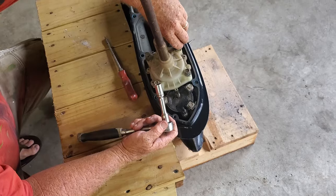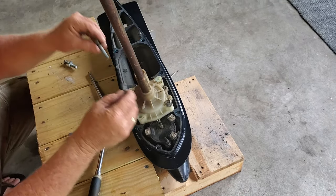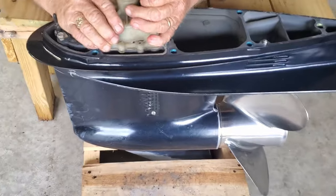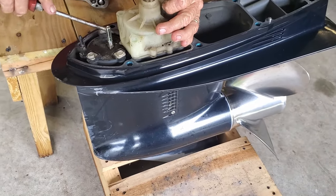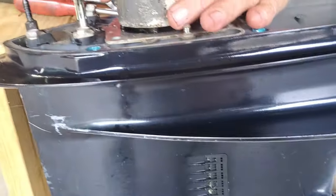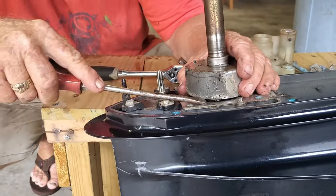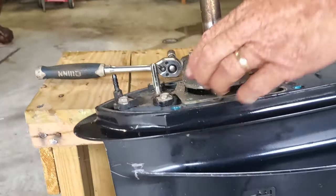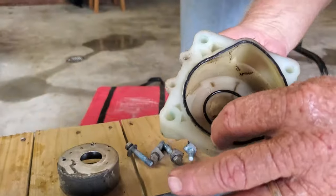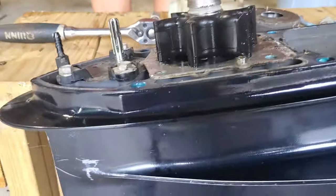We've got the lower unit. We've removed these four bolts — they have little washers that are directional, you'll see how they fit in those little cups. Remove these four bolts and your water pump housing just comes up. Give it a couple of wiggles, you may have to take a screwdriver and carefully push it. There's the plastic part — now your housing is still on there. The cup stayed on my rubber. I'll clean all this up. The O-rings look good, the cup looks good. We have run some sand through it.